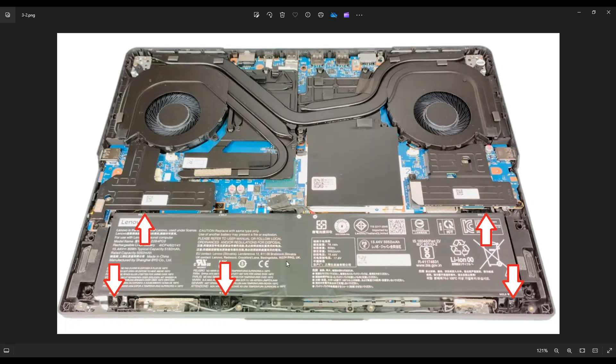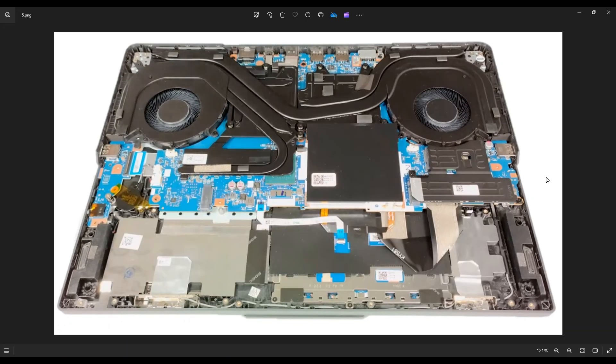After taking the screws out of your battery, there's the battery plug right here. You may see a black piece of tape on it — just peel that back and wiggle it out of the port. As with most things in a computer, try not to pull on the wires. Instead, put your fingernails on either side of the plug or use a pry tool and wiggle it out. Now that your battery has been removed or at least unplugged, it's safer to proceed into the computer.